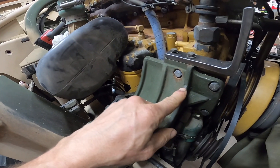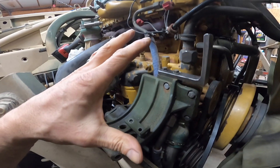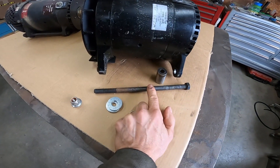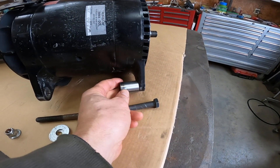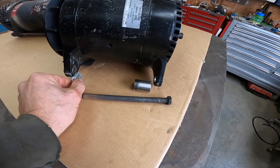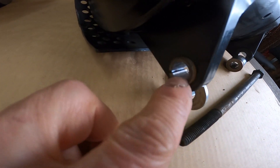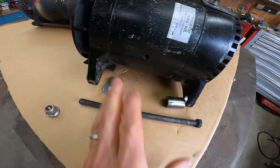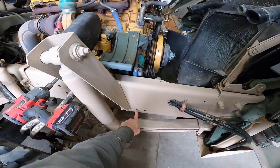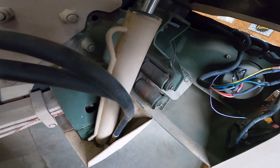I just have to fit that alternator in here and drill this hole. That alternator hits right here, so I'm going to hold that back just a hair and drill this hole, because the alternator doesn't move to adjust the belt — it's this adjusting pulley here that does the belt tension. I've got an inch and a half longer bolt; this bolt is nine and a half inches, with a one and a half inch spacer to get the belts lined up, plus a couple of washers. The alternator bracket goes right here, and a sliding insert takes up the rest of the slack so you don't have tension on your tabs. The only thing we're going to do on the truck is move the ground strap, because it will no longer reach from the alternator to this hole — I believe it'll reach straight down to one of these holes, which were for one of the wheels for the front winch line.